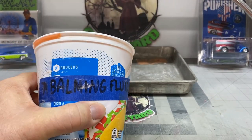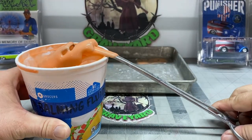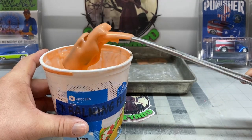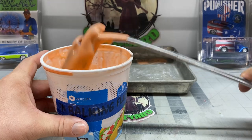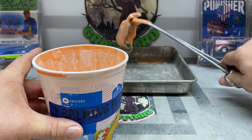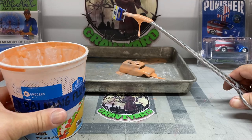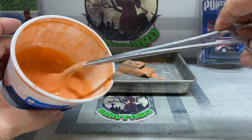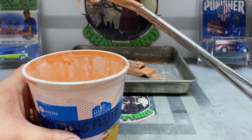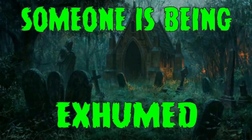Make sure you do all your cutting — you can go ahead and strip the paint first or strip it afterwards. I chose to strip it after. Go ahead and use whatever paint stripper you're using. I've got Citrus Strip here, or as I call it, embalming fluid. Shake off the excess, put it on the tray, let it rest. Don't forget to hit that subscribe button and click on that little bell. Here goes the back door — we did remove the plastic glass in the back because this paint stripper will definitely melt it. Set that on the tray and we'll get back to it.